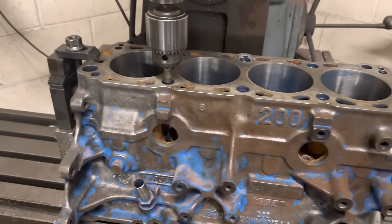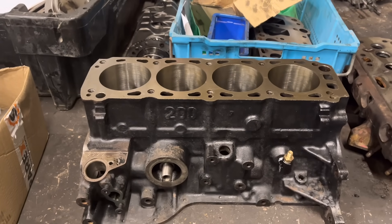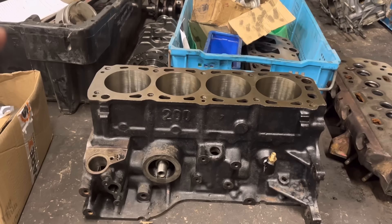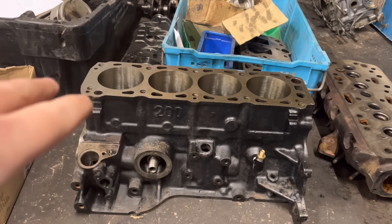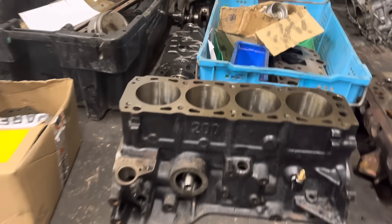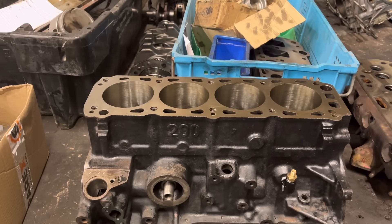And all the rest should be absolutely fine — that's what I'm doing there. Then this Cosworth block here, which I honed and bored yesterday, has gone to 92mm — just waiting for the pistons. I'm pretty sure, being Wiseco, that the clearance I've given it is going to be right, but we'll check that when they come in. This one is another that I'm going to be long-studding, so that is next on to the milling machine — and that's it for this morning's work.